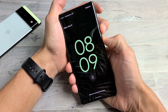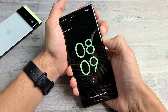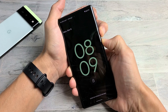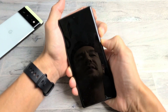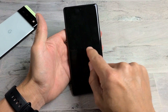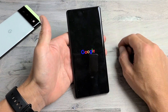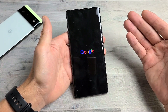Press and hold — do not let go. Pretend the screen is black and you have no idea what's going on. Just count up to 20 seconds, then let go. Give it a little bit and it should boot back up. You should see a Google logo — just be patient. There it is, Google logo. Wait for the boot-up and hopefully you're out of the black screen.